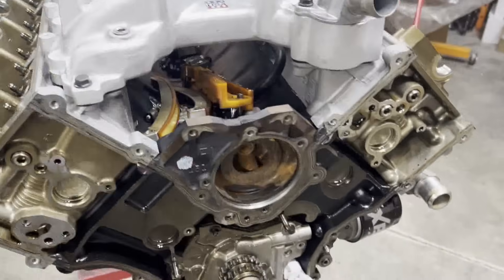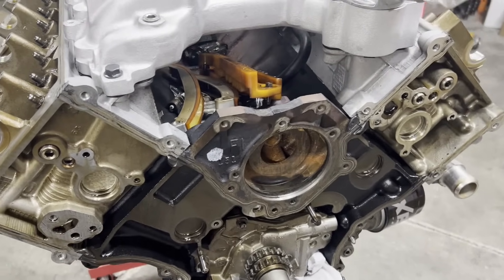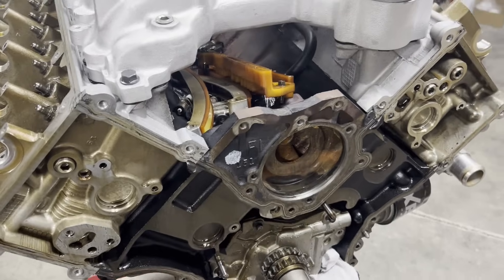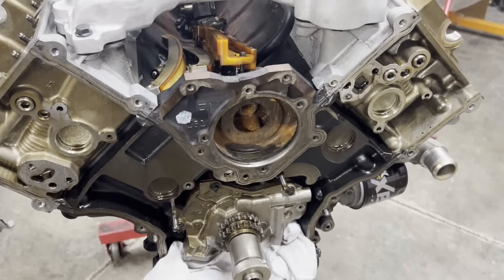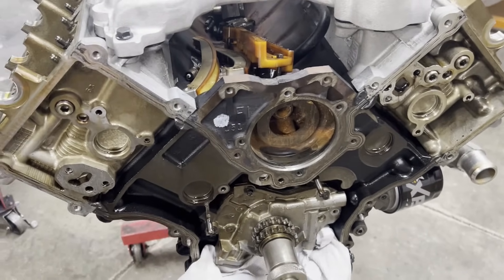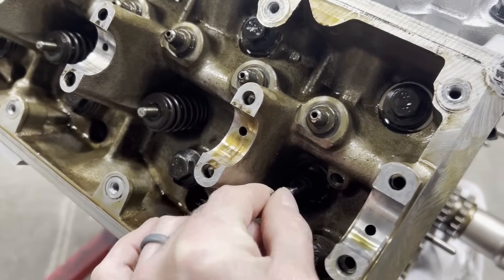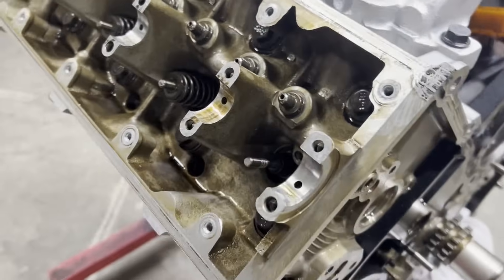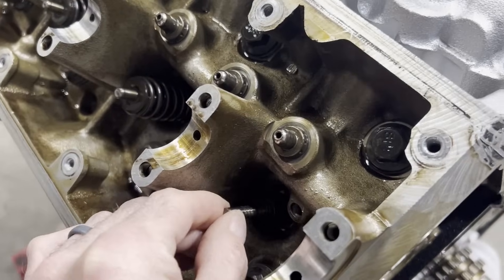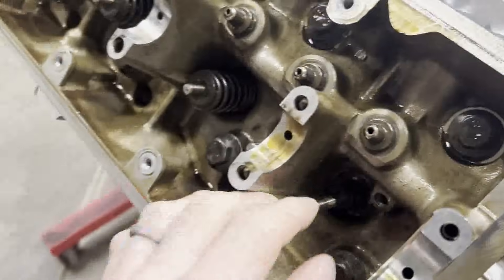What's up guys, it's Brent with Likens Motorsports. I've got the front end tore off of old OJ here and got the engine back. Had a few minutes to work on it — pulled the timing cover, the balance shaft cover, all the tensioners, guides, chains, and the cams. And if you notice, no valve springs here, so I'm able to freely move things as I need to. The reason for doing this is the crank is at top dead center, number one piston is at top dead center.